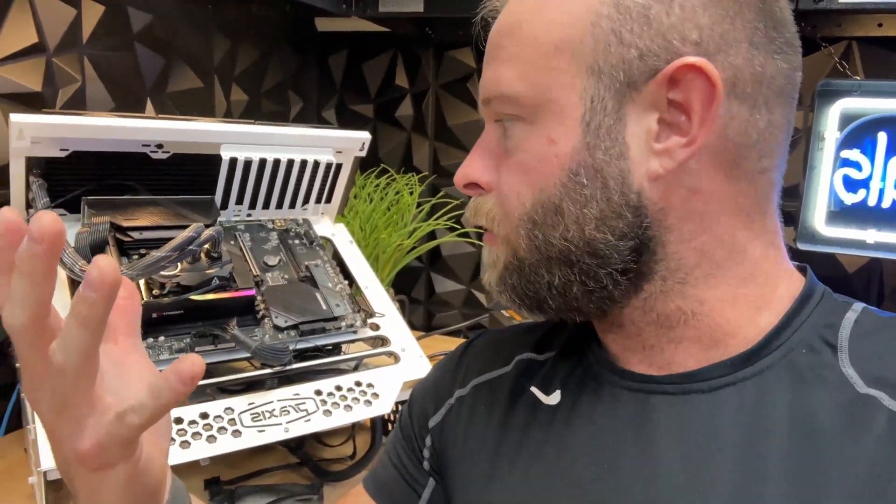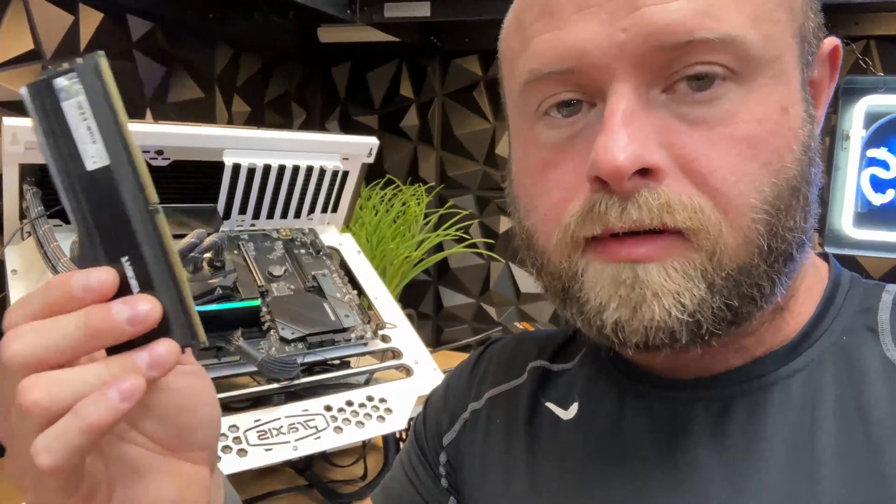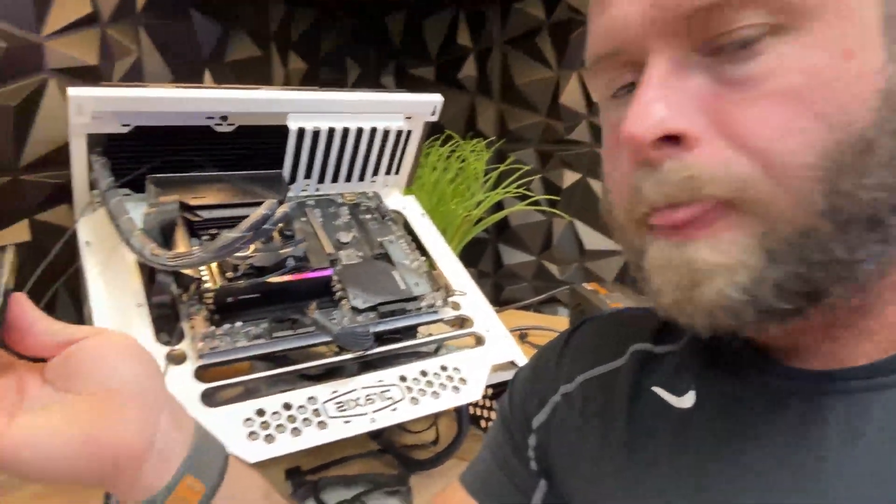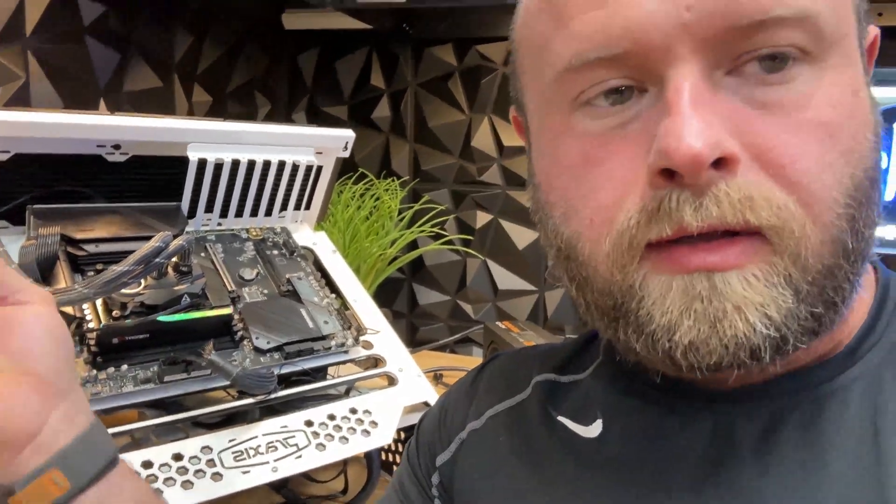It's the year 3000 and we finally got this thing working. As it turns out — bad RAM stick. In my whole career, never did I have a RAM go bad at all ever. But this seems to be the case. I was just trying every single combination of everything I could because these came as a mated pair. I took one out, swapped it and left it in slot one — the lights went off, booted up just fine. Updated the BIOS. We're hashing, we're in HiveOS. So that's a good thing.